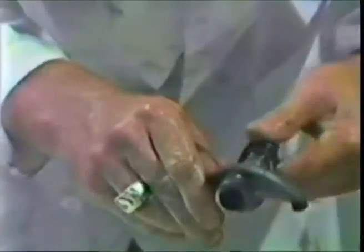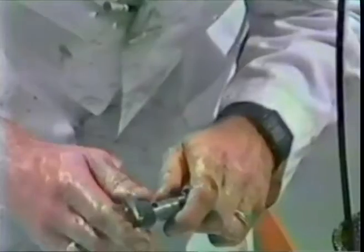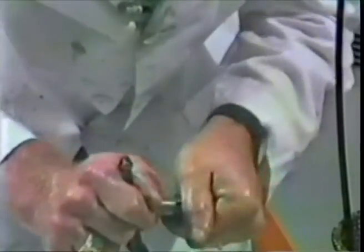Okay, do the long one then. Try this one. We'll find this buddy yet. This is why it really helps put everything together so that this is probably the hard one, the one that's very difficult getting off. It's difficult getting on too. We can use the same technique though as before. Put it on. They're usually distorted from people over clamping the nuts that hold the rocker to the rocker shaft. And that's why we're having some difficulty here.